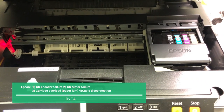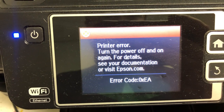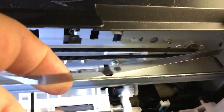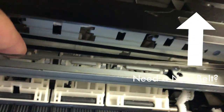To troubleshoot this, you have to focus on the timing belt, the clear belt on the back, and the mechanism that stops the printer. The first thing is to make sure this clear cable is clean, so the location is recorded accurately.